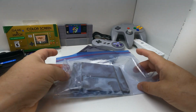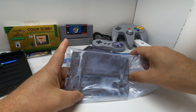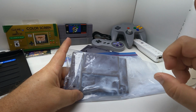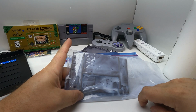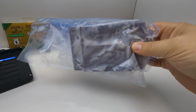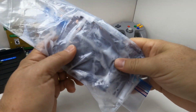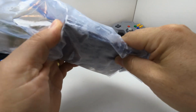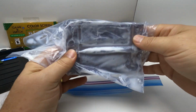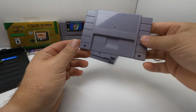And then what we'll do is I'll just stick it under the black light just like that. Let it run for 24 hours. We'll see how it looks tomorrow. For me, that'll be 24 hours. For you, that's gonna be pretty quick. You'll see the results here right about now. It's been 24 hours. We've pulled our RetroBrite treatment out from under the black light. I just need to go rinse it off and see how well we did. So let's rinse her off and see what it looks like.